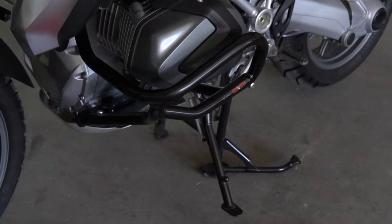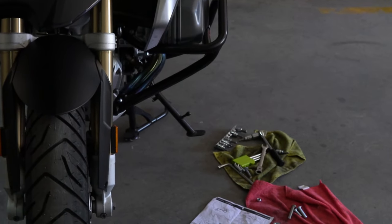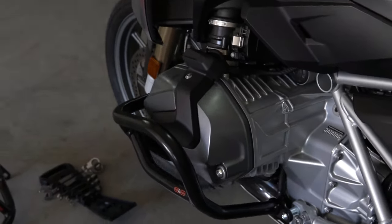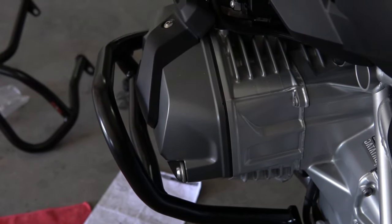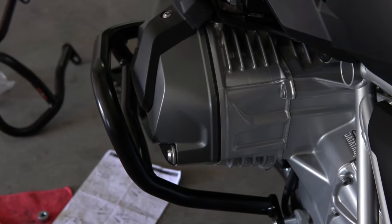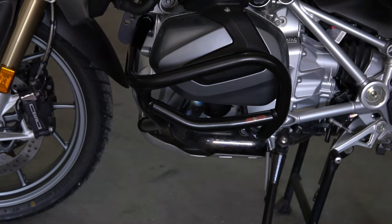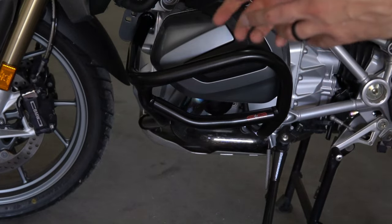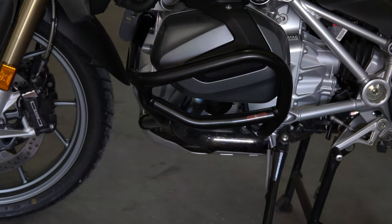So that is one side done. Not bad looking — it looks pretty good. Pretty easy to assemble, and got rid of a little bit of that gap. It's actually coming down quite a bit from where I thought it was going to sit, so I'm much happier with that. I just have to tighten everything down, but I'm going to look at the upper guards now. If you're going to put uppers or lowers on at the same time, it's always good to get everything situated first and then tighten everything down — because if you tighten everything super tight, you don't have any wiggle room. Sometimes you just need a little bit of room to fit bolts. So I'm going to do the other side now.